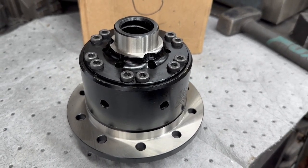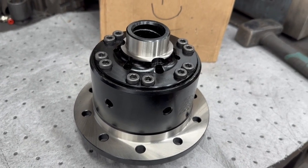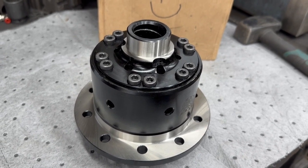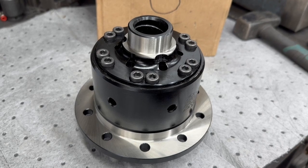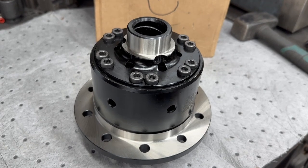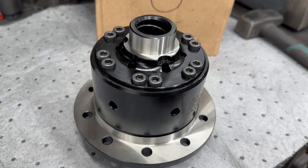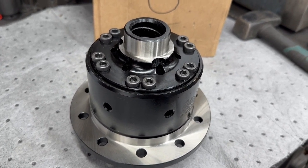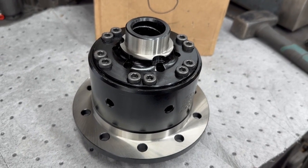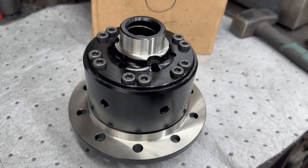If you dab the brakes, another trick is that if a vehicle has traction control, one of these units actually adds to it. Now the big problem with an ATB is it's untunable — and that's where this one comes in. This was a prototype which I've managed to get my hands on two of. This one is brand new, it's sold, and it's being built. The idea is that it has both gears inside — ATB — and plates inside, which I believe are carbon fiber. Those are tunable to give extra clamping on top, so when it starts to work, although it's a linear increase in clamping, at the very last minute you get this extra clamping which we can tweak and tune for front or rear. That is pretty unique in the marketplace.